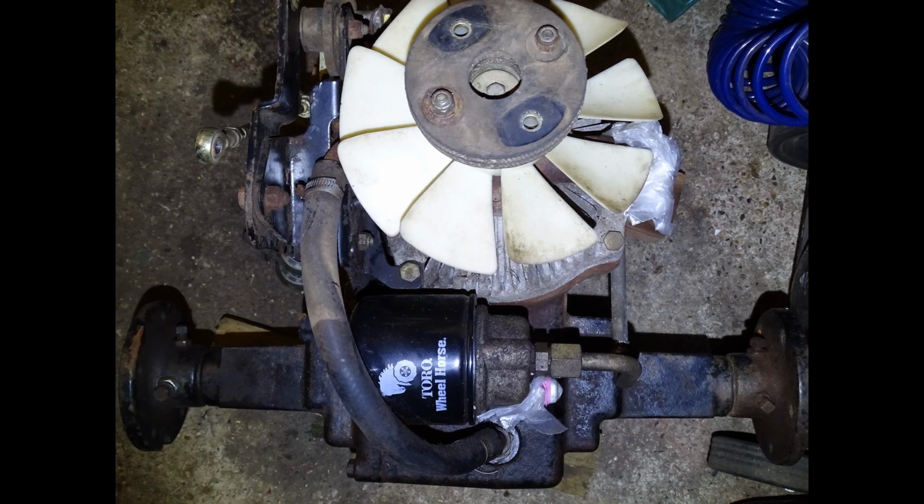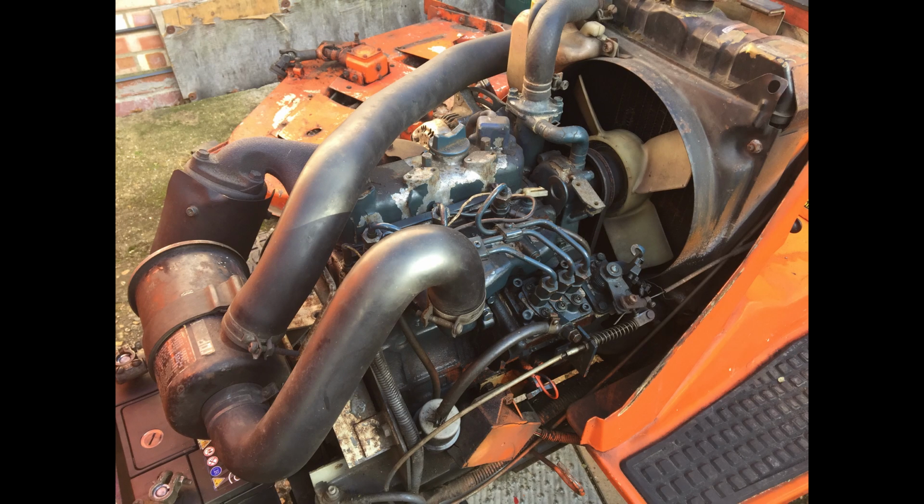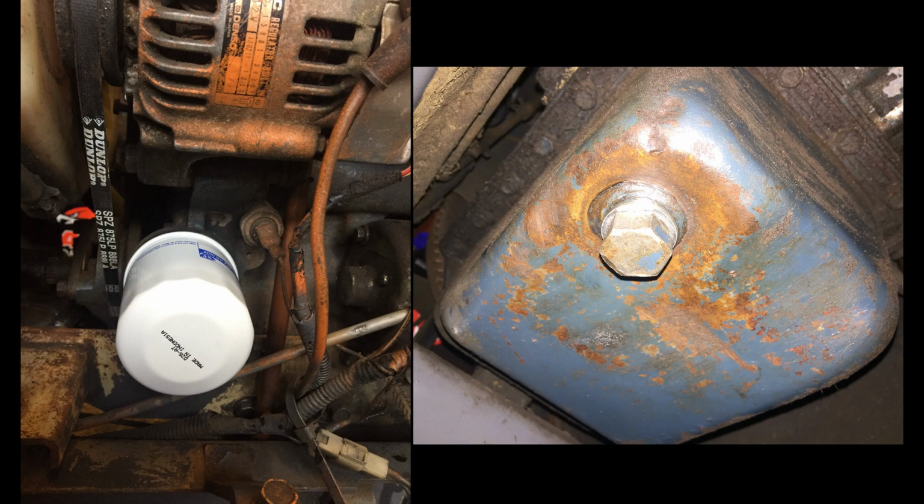On the other hand, an advantage when servicing the Toro transmission is the recommendation to use automotive oil 10W30 or 10W40, which is basically the same oil used when servicing the engine. So you don't have to worry about having old oil left on your shelves because you had to buy more than you needed. When it comes to servicing the Kubota, changing the engine oil is very similar to the oil change done in a car.